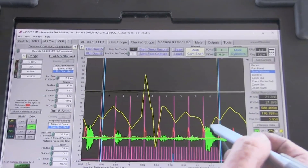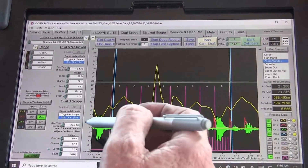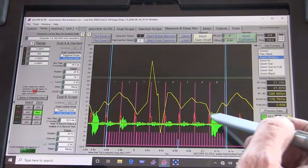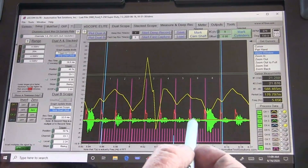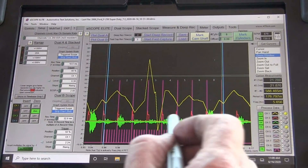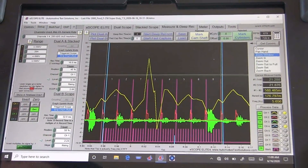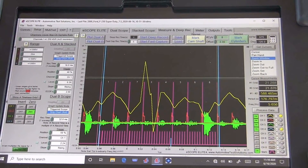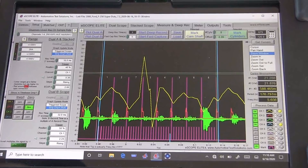So the problem is the number eight injector is bad. Apparently when this runs for a bit and the tips cool back down, it'll start running fine. But it's still started to run a little bit better just since we've been sitting here looking at this waveform. This is a problem and we can see where each one of these has a rise — do you see how I get a rise, a rise, a rise, a rise? I'm firing the fuel and I can tell if a cylinder fired or not by using my knock sensor. So this is my problem. We have our firing order counted out — eight's the bad injector. The shop is going to need to look at these injectors, but the injector is causing the problem and that's what's going to need to be replaced. Eight is the injector we're really worried about — that's the one causing the problem. So let's go ahead and go back to the shop.